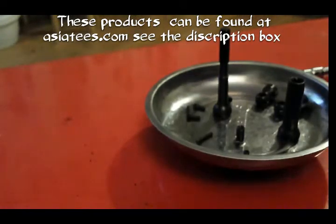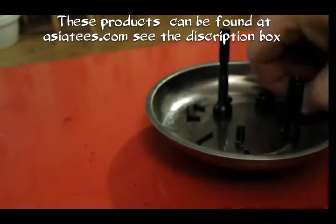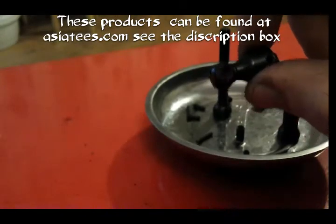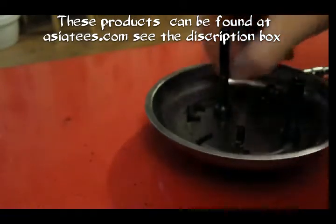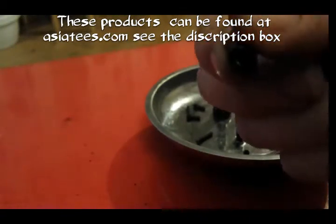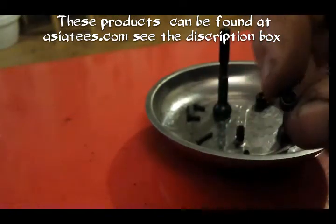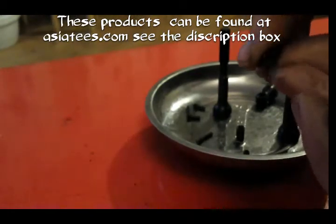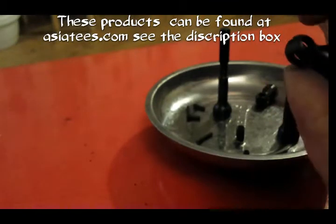Right, so to build them, you get one of them, it's a universal joint. Then you get this next piece, which is the sleeve that goes through. And what I have noticed is to put the set screw with a little bit of Loctite on it into the sleeve before you start building the shafts.